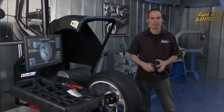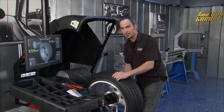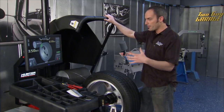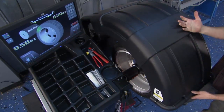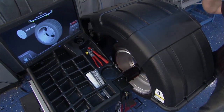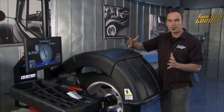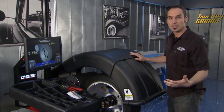Now this show isn't just about helping out a buddy on his car, it's also about some cool tools. I used to be a service tech and I've balanced a lot of wheels before, but I've never balanced one with a machine this cool before from Hunter. I'm going to balance this system but I'm also going to look at road force. Not only can I put balance weights on the tire when it's shaking around, I can look at this drum over here which applies pressure on that wheel. With sensors, I can figure out what the actual road is doing on that tire, which translates into my steering wheel and the seat of my pants.